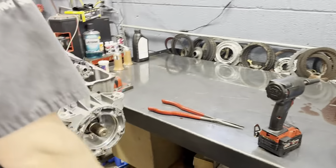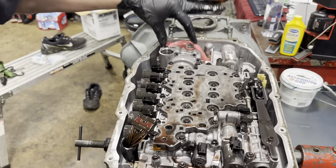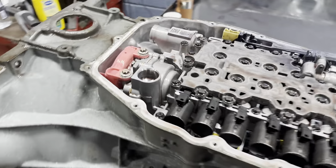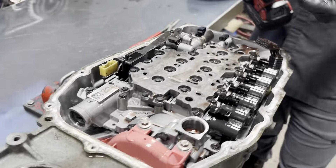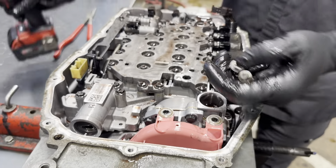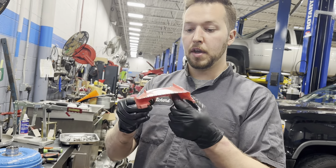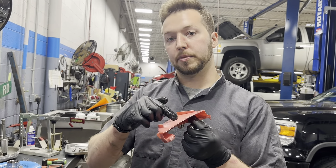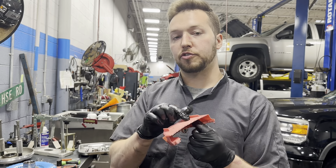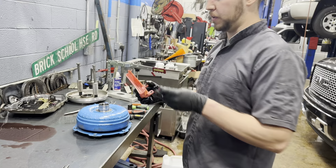Here's our harness, we're going to go ahead and throw it in the pan. And we are going to blast off our drive chain stuff. That's an external plus Torx, same size as the bolts that hold the valve body to the case. This baffle looks really good — they probably replaced this because this is actually white when it comes from GM. The reason it turns red or pink is because of ATF. So this looks like it was replaced, and that is good.